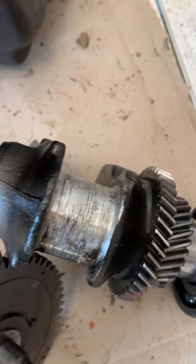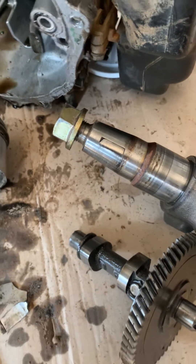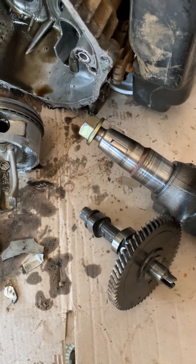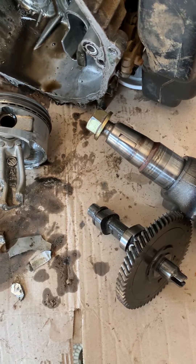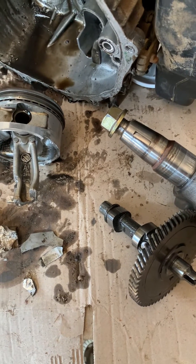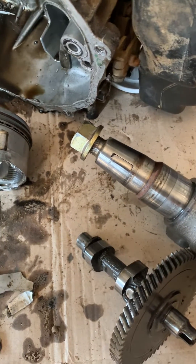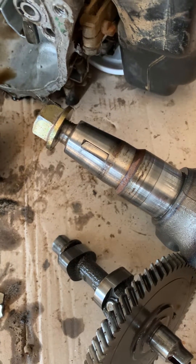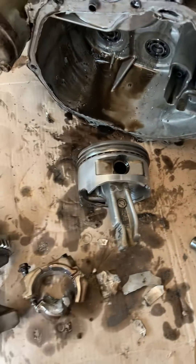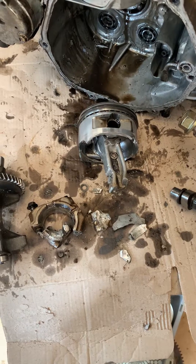I'm not liking my chances. I also noticed pulling apart that the keyway is sheared off on the crank, so that would explain this engine missing a little bit. For those that don't know, these little single cylinder engines — you can't really adjust the timing, it's set and forget. But that's done off the flywheel because it's got a magneto. So if this keyway is sheared, it'll fire at a different time — it's adjusting its timing on its own, and they sort of cough and splutter, which this was doing before it did die.